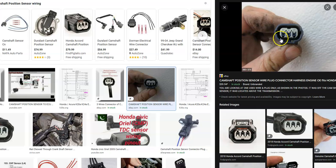Quite often what a mechanic will do is take the sensor off, insert it into the harness, put the key in the on position, come in from the back of the sensor, and read from ground to the return wire to the onboard computer. Put a piece of metal in front of the sensor and see if it goes from five volts to zero — you'll know if the whole circuit is working. There are YouTube videos on that technique if you want to get more involved.